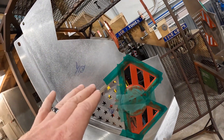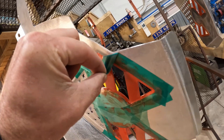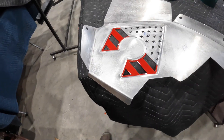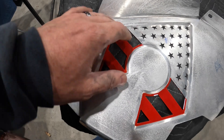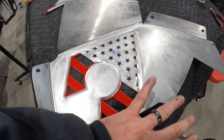The clear has now just flowed out. We're going to peel this tape off while it's still hot — I'm going to put the camera down so I can do this without making a mess. There's the red! It definitely looks a lot different once it's flowed out — it's a beautiful color. Now we're going to tape this off and hit it with the super mirror blue, then work into our final stages with the black.